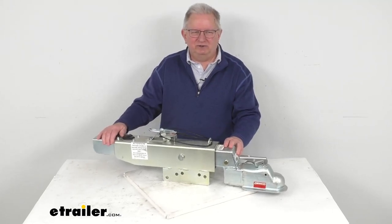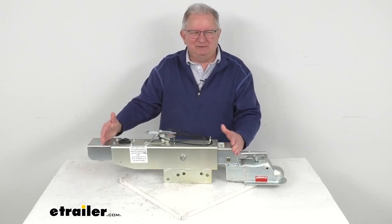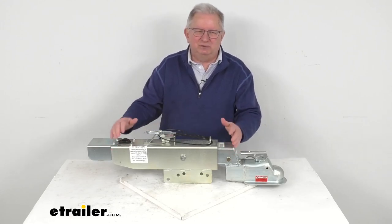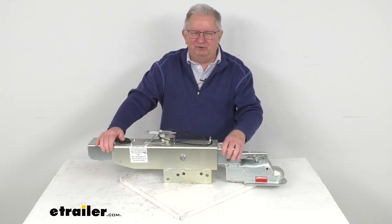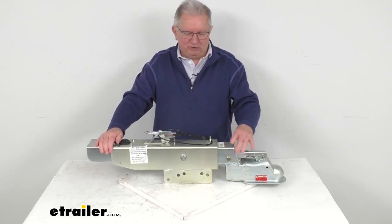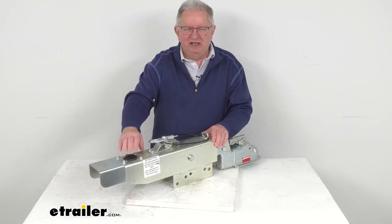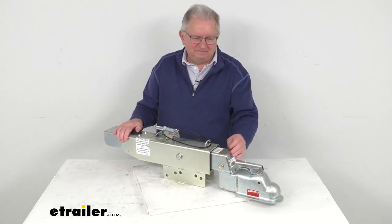This hydraulic actuator is what will activate your trailer's brakes when your tow vehicle slows or stops. Basically, when you apply the brakes in your tow vehicle, deceleration occurs and the momentum will push your trailer toward the rear of your vehicle. So with the surge brake system, this actuator is triggered as your trailer moves forward once your tow vehicle starts to slow down. The actuator will contract — this inner slide here will slide into the outer case — and it applies force to the master cylinder in the back, which then supplies the necessary hydraulic pressure to engage your trailer's brakes.